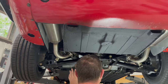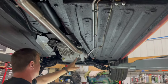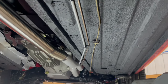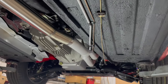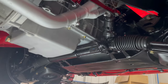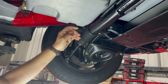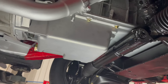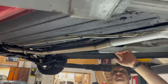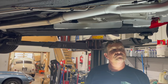The exhaust goes up over the axle and then into one section, all the way down to our tubular manifolds which have been ceramic coated. We've got fuel lines, handbrake cables, brake lines — brakes are all bled. Steering is all in and plumbed. Pretty much underneath here, bar a few little wires still to connect, we're pretty much done. Once it's up and running all I've got left underneath is the geometry setup, tweaking the dampers, and a couple of cables to sort — but the gearbox side is all done.